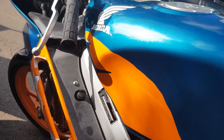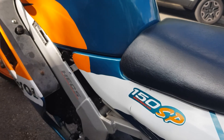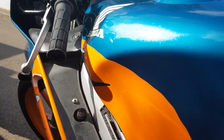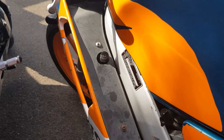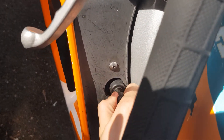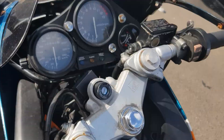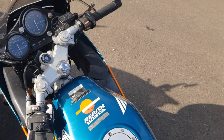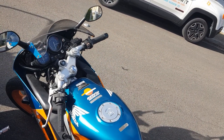So now, this is what you should keep in mind if you have a two-stroke motorcycle like this one. The choke may confuse you when it causes the engine to not run. Because if you do the choke all the way, that's going to flood the engine with petrol and eventually the engine just won't go. That's why my bike stalled at the lights and wouldn't start again.